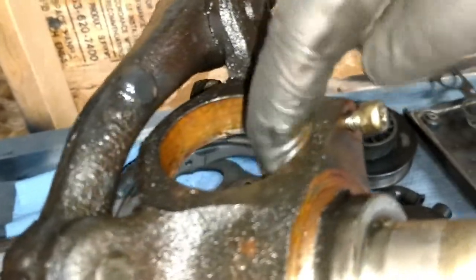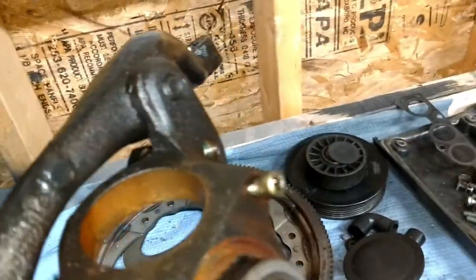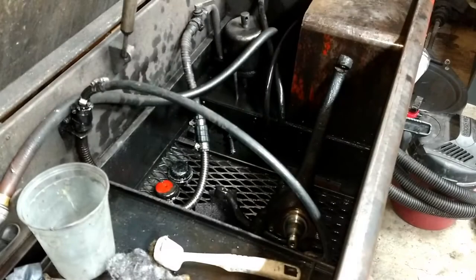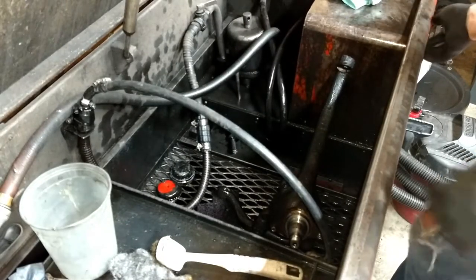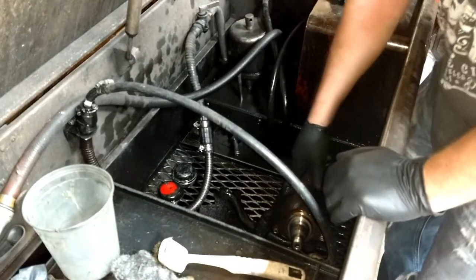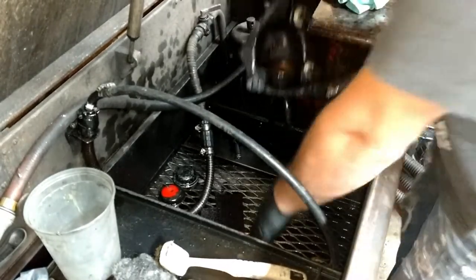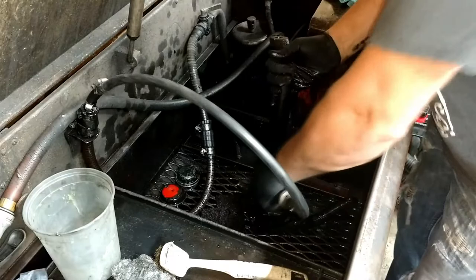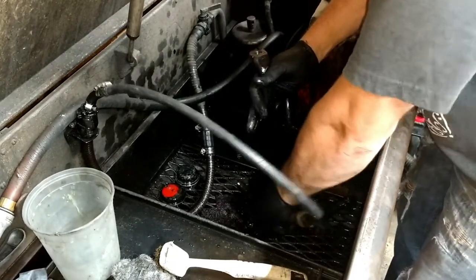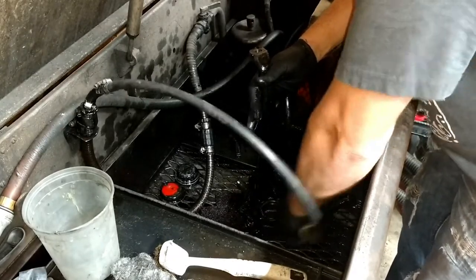You have little grooves there that bite into the ball joint — see the grooves that are left over? That's from the little grooves on the ball joint. After that, I bring the parts to the wash tank — there's no rubber parts on it anymore, the ball joint's out. It really lets you clean it real good so you can repaint it with factory semi-gloss, which is what they use on suspension components.